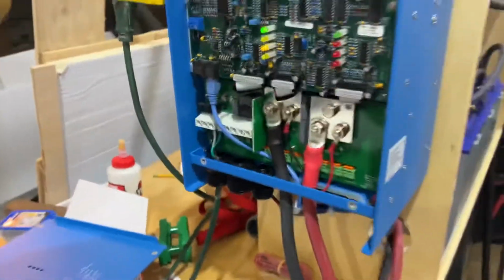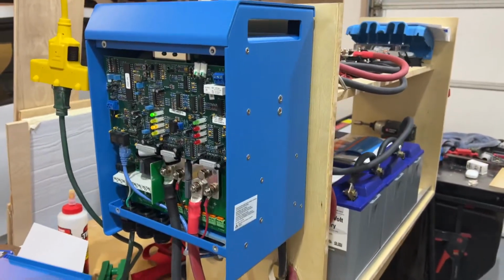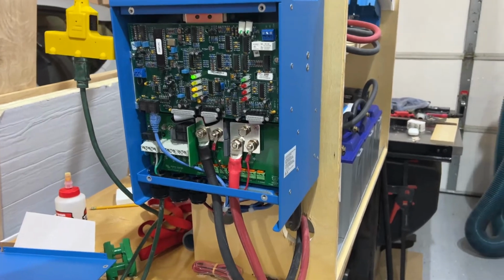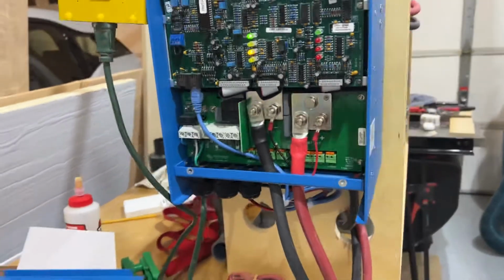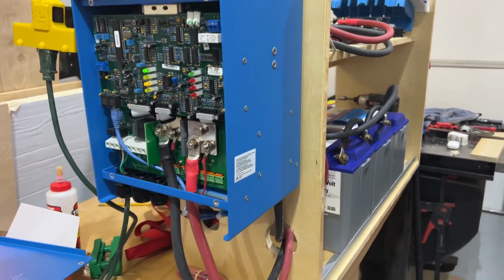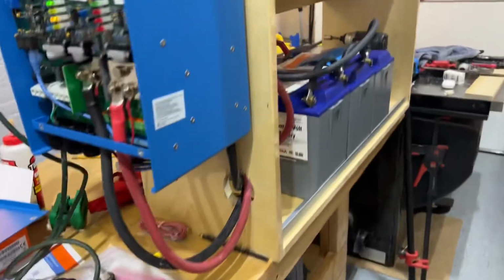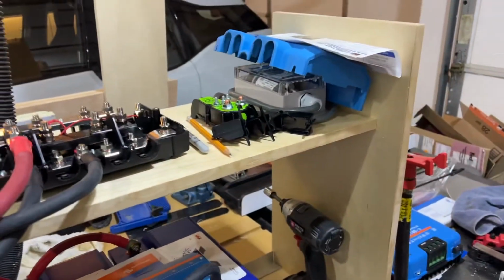Anyway, I'm ready to start wiring up the van now. I've got a lot of the wiring run. I've just got to figure exactly where I want to put my distribution panels up in the upper panel. The theory I've got here is that I'm going to run heavier gauge wire from here and put the distribution panels up closer to their destination so that I'm not running multiple thinner gauge wires from here somewhere on this setup off to each independent little device.